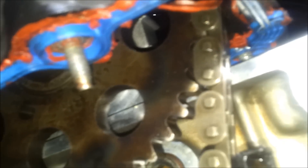What you can do is — the cam doesn't need to be in the right spot — put it to wherever it springs to naturally. You can see that I've lined up the mark — there's the mark — I've lined it up with the off-colored chain link.